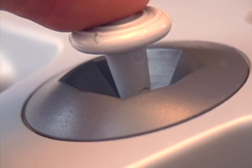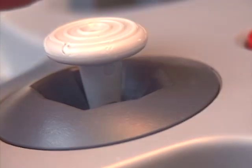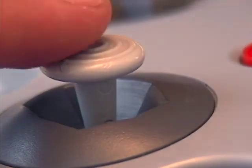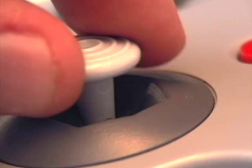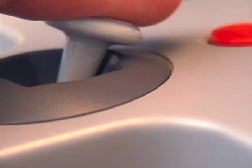From this angle you can see that if I rotate the stick, the analog stick doesn't touch the dark gray part - it's held up nice and high. A lot of analog sticks will sort of fall down, and when you pull them left, right, up, or down you can feel them rising up. This stick is not loose in the vertical direction. If I push it forward, back, left, or right I don't feel it pulling up. It's always at the same height, and when I push it forward and apply some pressure down, it's not touching the dark gray part. It's just good as new.